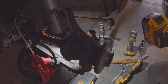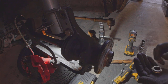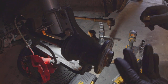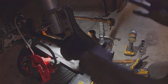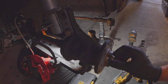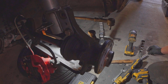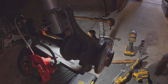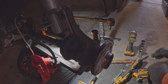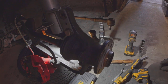We figured out why the bearing failed — our nut backed off. The way these bearings work is that they need the tension of the axle nut on the end in order to support the bearing properly. Our axle nut was pretty much finger-tight because it came right off. If it's finger-tight, you're screwed, because I think the actual torque spec is like 200 foot-pounds or something. That's why it failed — installation error or just working loose over time.